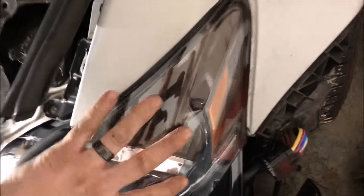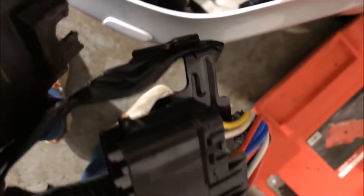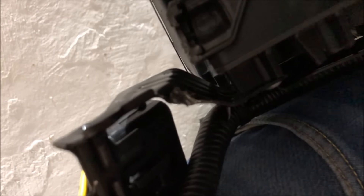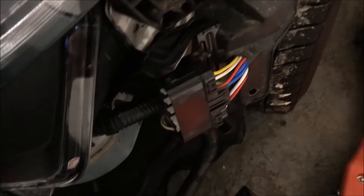When we tried to install this headlight, there would be a little gap right here that would bother me a lot. No matter how hard I would press on it, you could feel that something is not letting you go in. If you look at this headlight, this connector right here — this big one — is held on by this weird metal arm that sticks out. This metal arm was actually pressing against this part of the fender and wouldn't let it go inside. What I did is I took a pair of pliers and where you see the little white spot in the middle, I just bent it back a little bit. The headlight came in right away. That took me about 40 minutes to figure out, but hopefully it saves someone time.